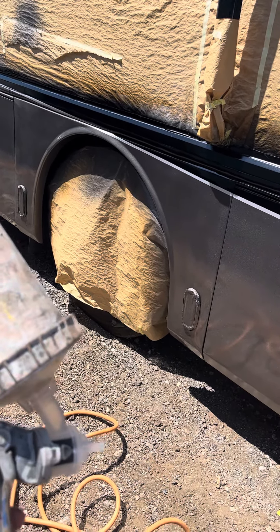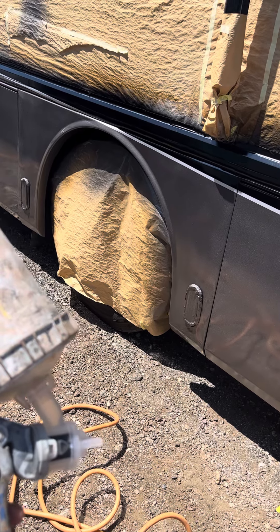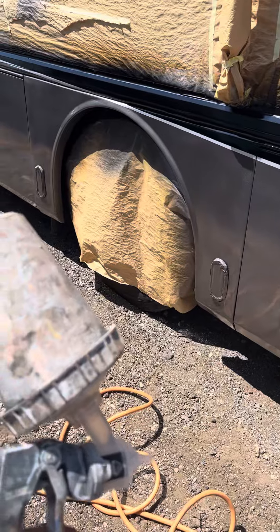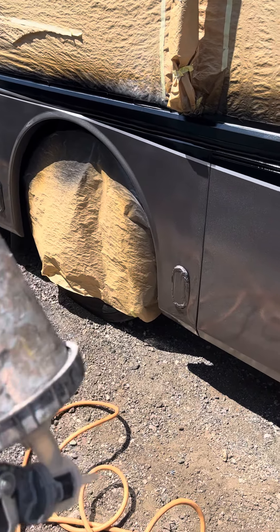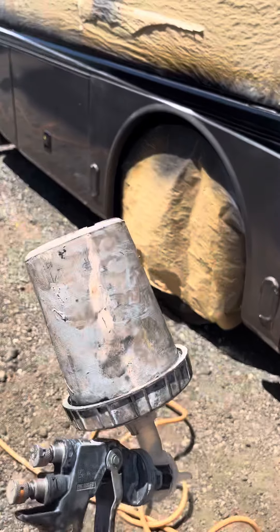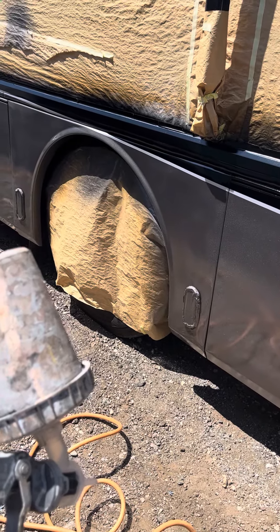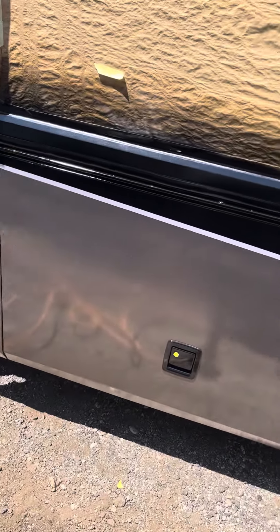The clear coat is mixed 50% reduced — so even 60-70% reduced on the first pass. The reason I do that is so the atomization is so tiny that you don't get fisheye, and not only that, but you don't get too-big splatters. They're real small, real fine splatters, as you can see — just very fine.